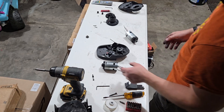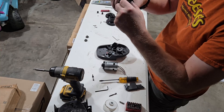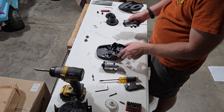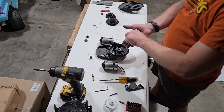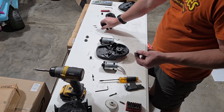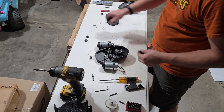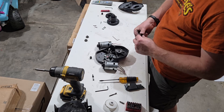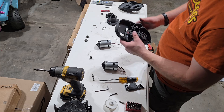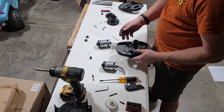As far as I can tell, this spacer is good to reuse — I don't see any reason to not reuse this one. I'm going to leave this one, nothing to do there. M4 by 12 — I had M4 by 12 and M4 by 16. The 16s were too long; I ended up stacking quite a few washers and it was still a little too long. So I went with the 12-millimeter, but then I couldn't use the washer to get it to bite on the nut in the spacer. I don't like not using the washer because it's just going right on the 3D printed material, but I think it'll be fine.